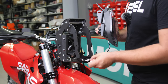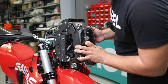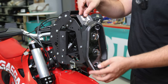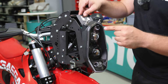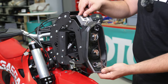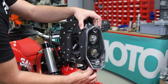Run the position light wire through here in the middle. If it's too tight, slightly push the bracket so that you manage to slide the headlight through. Place the lower bolt first — here you'll be able to adjust the tilt angle of the light since this hole is slotted on the bracket. You can also fit a Baja design light if you don't need it street legal. This is the street legal version with the Hella homologated lights. Once the headlight is in position, tighten the bolts underneath the retaining bracket for the windshield.